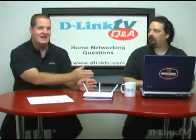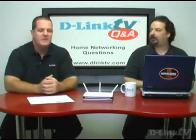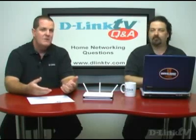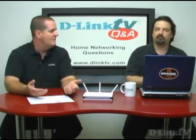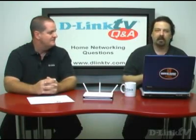You probably would like to see the 108 megabits the box talked about, but you're still going to get better range and probably better throughput with your draft-N router. With the multiple antennas, it handles interference better through walls and things like that. So at a given distance, your N router is likely to allow your G adapters to get better actual performance than they would if it was all G. Plus, this way you're more future-proof — as you upgrade your laptops and PCs, more and more are starting to come out with N built in, and now you're already prepared for it.